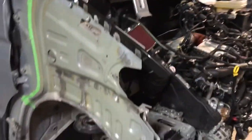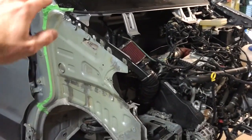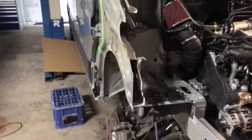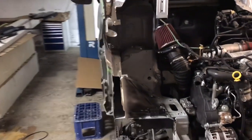This top piece is done — well done. So everything is done welded now actually. I had the side fender on, I had the engine cover on to check that everything fits perfectly, so I know for sure it's where it should be. I also start masking here now. I'm going to do the same on the inside — mask everything, sand everything, then paint epoxy and filler. That's the next step.